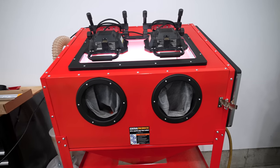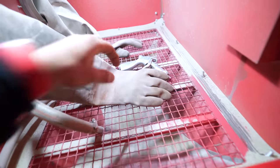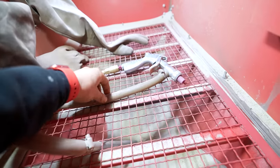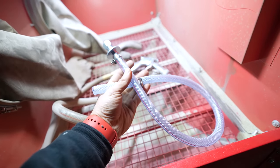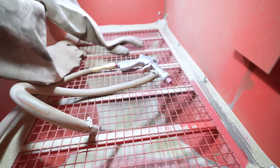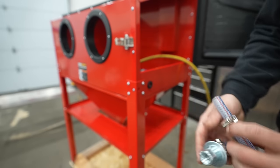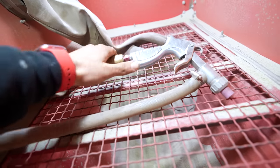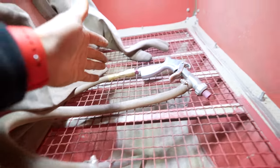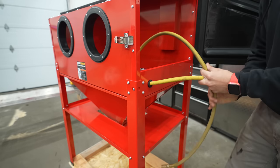On the note of not installing parts that come included with this blaster: if you install everything correctly you'll have your sandblasting gun inside, the air supply line, and the siphon feed for all of the media. If you install the included hose which hooks up to the sandblaster's air supply, you will have leaks because the only thing preventing this from leaking is a little worm gear clamp that bolts up to a male fitting for the air inlet. My suggestion is to literally throw that out and buy a proper air compressor line that has a quick connect so that if you want to take out the hose or install a different gun, you can do that easily.